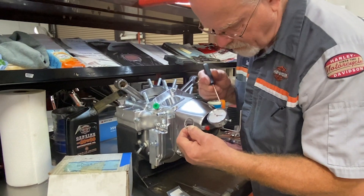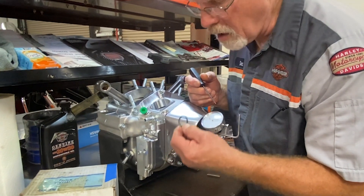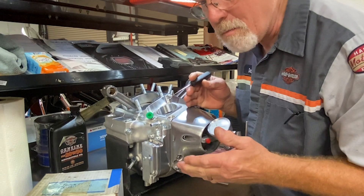So I've chosen a seventy thousandths washer. That will give me eight thousandths — pretty close to ten. I'm going to get a seventy thousandths washer and put it behind, then recheck just to be sure that I've got my minimum.